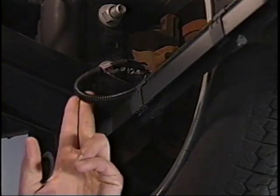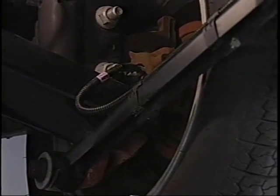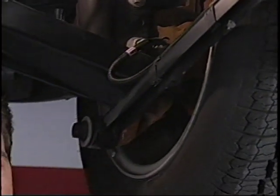Anytime you diagnose an anti-lock brake system, check the car carefully for aftermarket equipment. Some aftermarket installers are not very careful. Mounting screws are driven into the body sheet metal and through wheel speed sensor wiring harnesses. Some installers think this wiring is a power source. Others think it's a ground for their device. Wheel speed sensor circuits are very sensitive. Any disruption of the intended signal causes the EBCM to set wheel speed sensor codes.